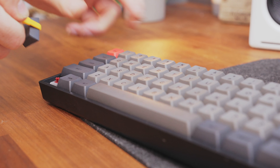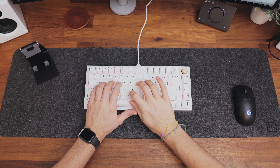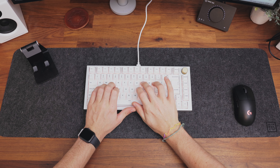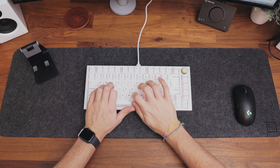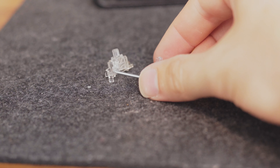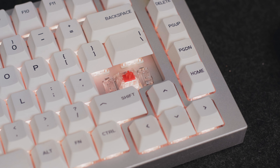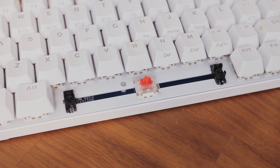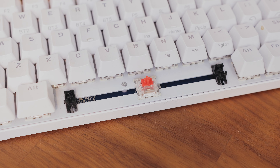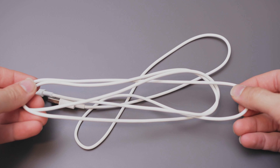If you've ever heard some of those juicy keyboards online, there's a good chance they have what we call a gasket-mounted plate design. All this really means is that the mounting plate for the switches and stabilizers is mounted in between a layer of sound-dampening foam, which creates a deeper and more full-sounding keyboard. It's just one of the ways premium boards differentiate themselves from a less expensive board. More premium boards also offer different kinds of stabilizers, and in the case of my GMMK Pro, they have their own customized GOAT stabilizers that they design themselves, offered for only $5 when you buy the board. Stabilizers on more premium boards also tend to be PCB-mounted, which just adds more thock and deeper noises to the keyboard when you're pushing down the keys.